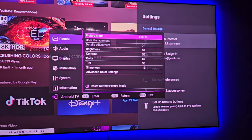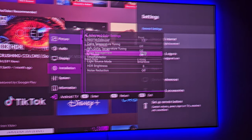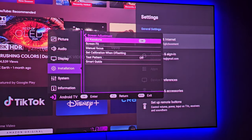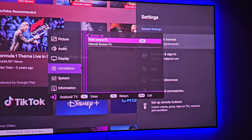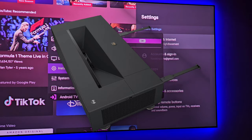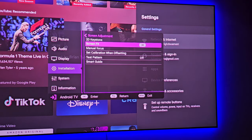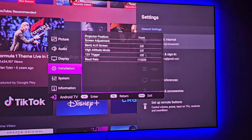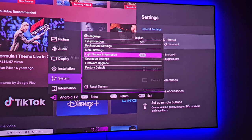The projector menus give you so many options across different picture modes that you can experiment with, plus all kinds of calibration settings to tune to your liking. Ultra-short throw projectors are finicky about placement — how far below and out from the screen — but the projector has ruler guides on the unit itself indicating distance from the wall for various screen sizes. Auto-screen fit is an awesome feature, and quality-wise I really didn't notice much resolution loss from where I was sitting. Ideally you don't want digital corrections, but that's not a reality for many people.